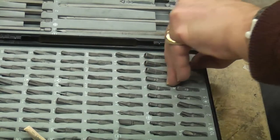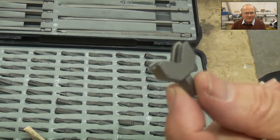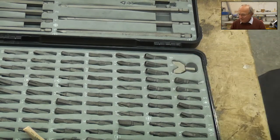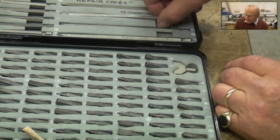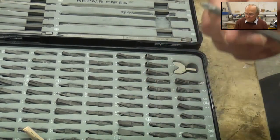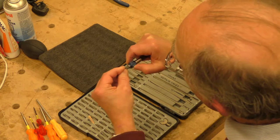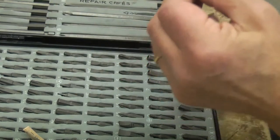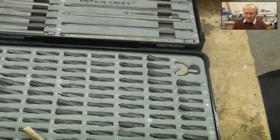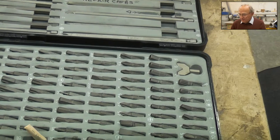There's one bit in here I'm not sure about — the vote from the group was 'turns hooks' — yes, that makes sense. Also very handy in there are some really deep hex bits, because increasingly manufacturers are putting their screws down at the bottom of deep holes, and you can't use a regular hex bit because the chuck gets in the way. Unfortunately there aren't yet some really deep Torx bits, which is the latest thing domestic appliance manufacturers are using, and we could really do with those in the kit.